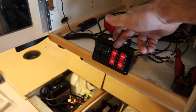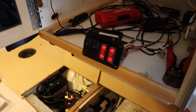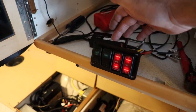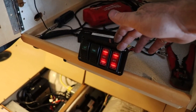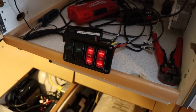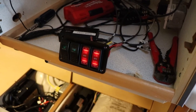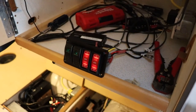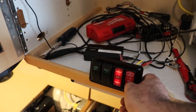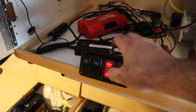So now we are charging both sets of batteries at the same time. That is the DC load center. Depending on how the Road Trek is wired and where the charger is hooked up, you need this to close, and then this one is closed. It's charging the battery in the front. So if you wanted to run your radio all the time now, you could — your battery is going to be protected, it's not going to get run down. And if you wanted to turn it off or separate systems, you could do that. Put it back to auto and it's going to close in eventually.